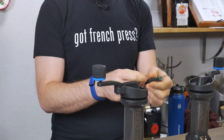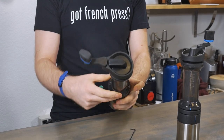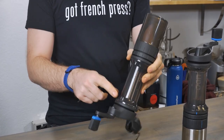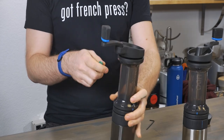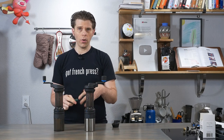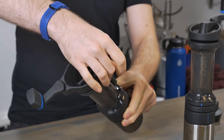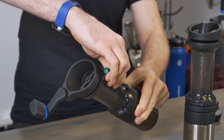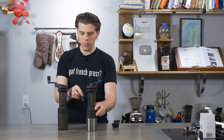The good news is you only need one tool to take the Lido 3 apart, and it is included with the Lido — a pretty standard hex wrench. You may also want to have a right angle hex wrench as well. The reason for that is that the screws for the Lido — there are four screws that surround the bottom of the grinder, four screws at the top, plus a screw in the center and one at the bottom — and those screws can be a little tight when the device is new or from the factory.